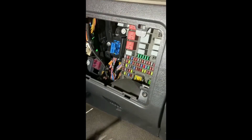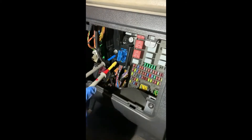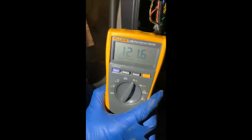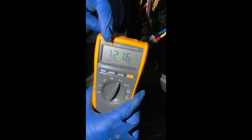If we go back to the OBD plug at the moment, the circuit is now reading 120 ohms, because essentially we now only have one 120 ohm resistor in the circuit. The other one, which is obviously in my hand, has been taken out of the circuit. And that 120 ohm resistor we're seeing here is the one that's in the engine control module.